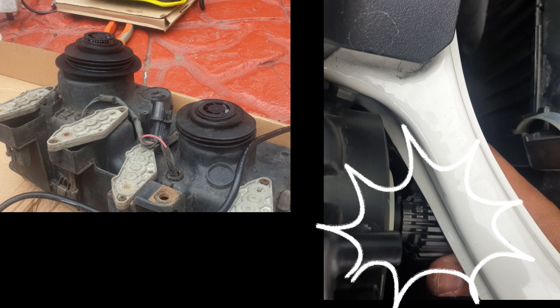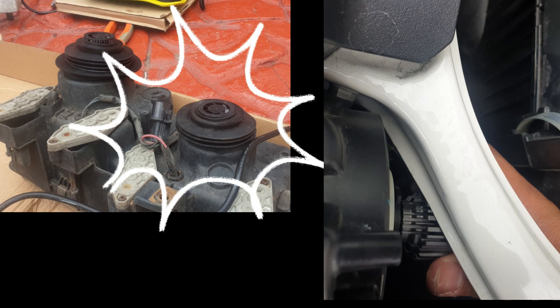You should also check the design of your headlights first since these LEDs are larger than a stock bulb. For example, on the Toyota Vios 2019, many LEDs cannot fit on the high beam because the LED fan hits the frame — only those with a 30mm and below fan diameter or fanless LEDs are able to fit. For the Mitsubishi Delica, the headlight cover was changed to a universal rubber cover since the original could no longer be closed, and the fans also need to be exposed for heat management.